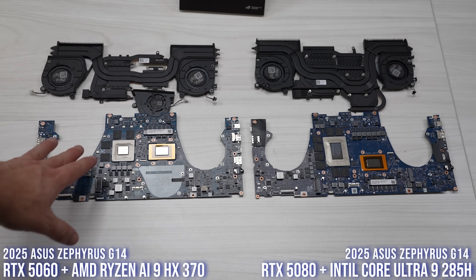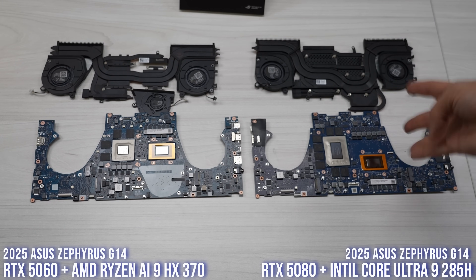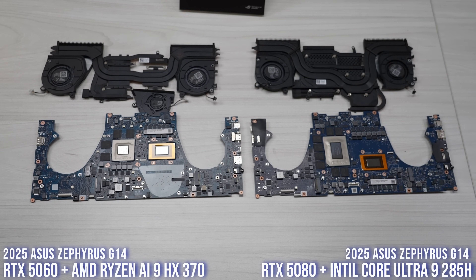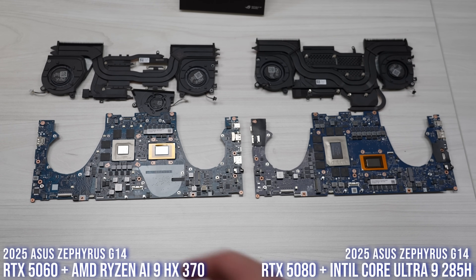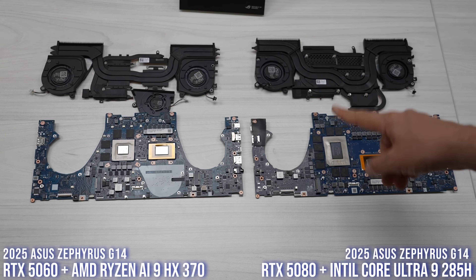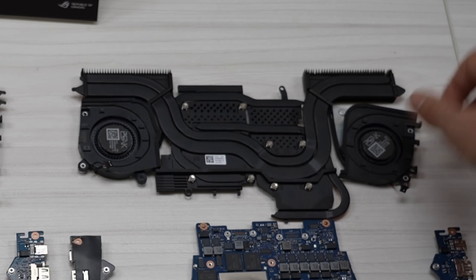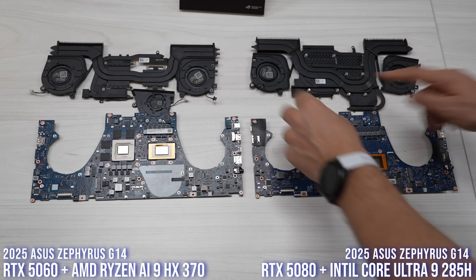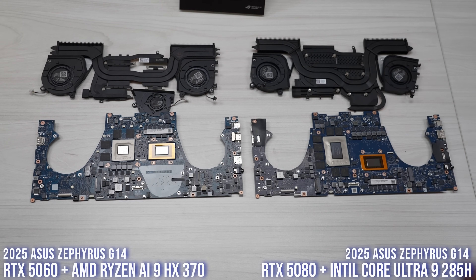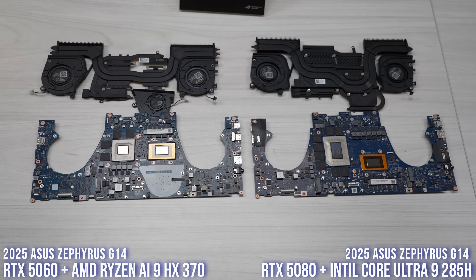So it's very similar. What's the GPU wattage difference in the Zephyrus G14? The 5080 is 120 watts and the 5060 is 100 watts — so 20 watts more. With all of this: boosting one heat pipe from 6 to 8mm and adding a second 6mm, we're able to get an extra 20 watts out of the cooling solution to accommodate the 5080 and 5070 Ti. Is that only a two-fan versus three-fan design? Correct — the 5060 has two fans and this one has triple fan. A clever thing here: the fan chambers are open on the side, so some air gets blown out there and flows over the heat sink module on the other side. That's why we have these rubber guides — very soft rubber that guides the airflow in the direction we want, rising up and leaving on the exhaust.